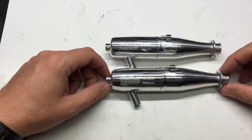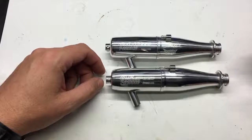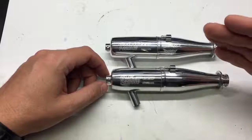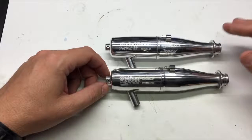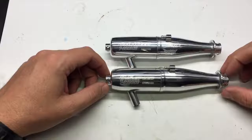The nice thing with the 2100 is it's just a really good tuning option. If you get on a track and it gets bumpy, blown out, or the grip is a little bit lower, you can switch between these two pipes. It'll shift your power curve slightly. But overall, the tune will be very similar, and the feel will also be similar other than being a little bit smoother on the bottom and slightly more aggressive through the mid-range.